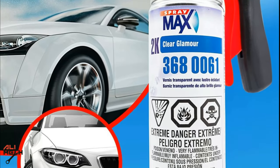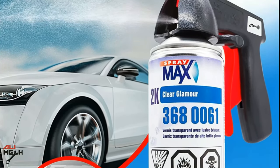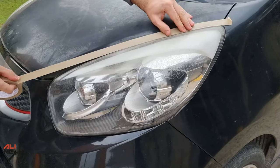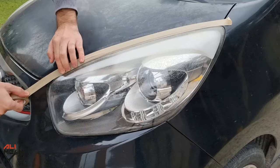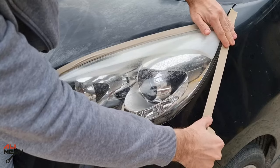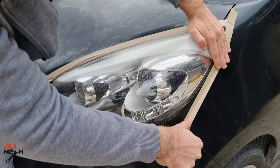You can use clear coat with hardener, or you can use a spray can. But make sure it's a 2K clear coat — they are UV resistant. We're going to be sanding the headlights down through the factory-applied clear coat and a bit more to remove the cracks.